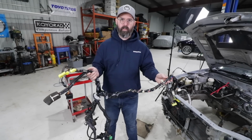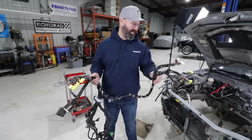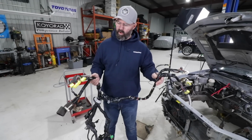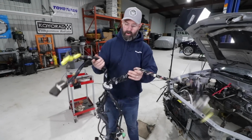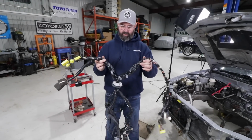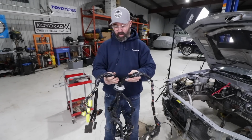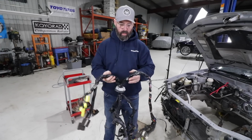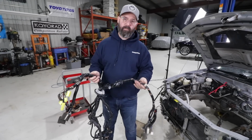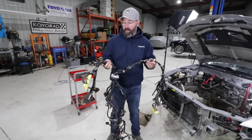I think they think you're never going to change your engine harness or really service any of the electricals the way they've designed it. Is this supposed to be a rally car? Weird. Yeah, I'm really puzzled by it. In any case, this is an opportunity for us to send it to Ohm Racing and say, listen, make a disconnect here and maybe a disconnect here as well. And then the engine harness just separates out cleanly. So our deep sea fishing expedition, I think, has paid off in the sense that we'll be able to make it serviceable, make it much cleaner.